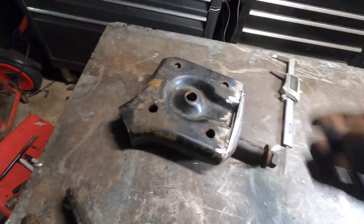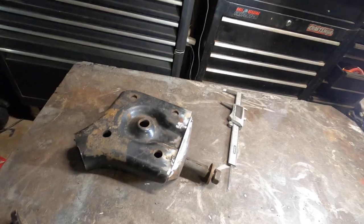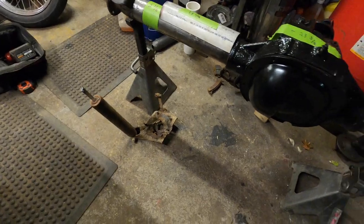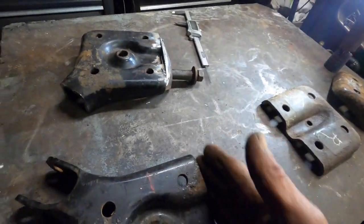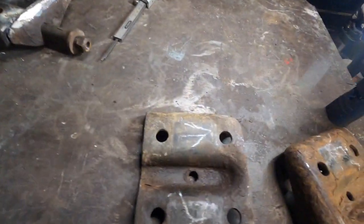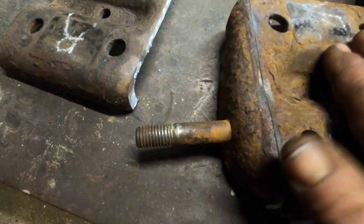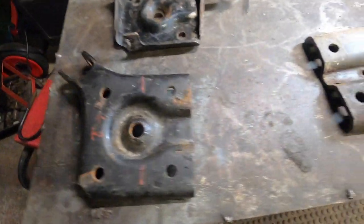So, I know that's rather confusing, but that's where I'm at. So, take the Ford Explorer shock mounts, switch them from left to right, and turn them 180 degrees, so you get the flush side here. Now, this would be into your tire when it's on a truck, so you have to cut it, which I did there. Then I cut the S10, or Blazer, whatever you want, shock mount off the mount, and I welded it to that flush side. This is just tacked on here. So basically, that's how I'm making my shock mounts.